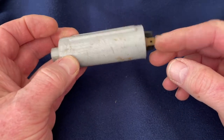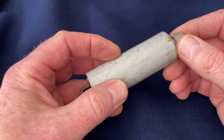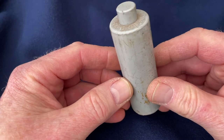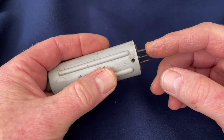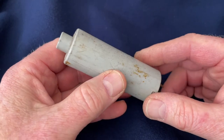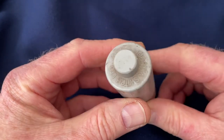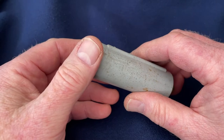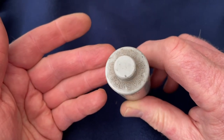The plunger is connected inside to the terminals and breaks or makes the circuit. It's actually actuated by a heavy ball inside here which normally resides in the base, but if you have an impact, a rollover, or sudden deceleration, the ball gets thrown up on the inside and breaks the circuit, thus breaking the power to your fuel pump in the boot. I've seen online one or two people who have also connected these to the distributor itself, so it will actually cut the engine as well as the fuel — not a bad idea. It's a very simple idea but amazingly advanced when you think that these cars were made in the 1970s.